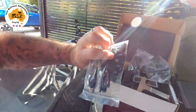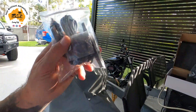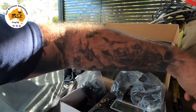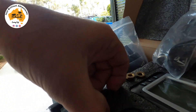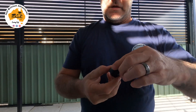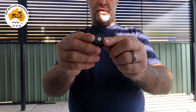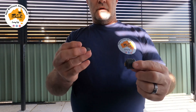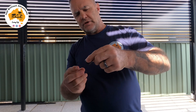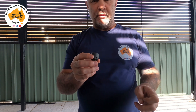That there is a little extender aerial — with the caravan, this allows the monitor to read all the way back. You can put this aerial in your car if need be; I've found in the past I haven't had to worry about it. Now I'm going to take one of the little sensors out — all the sensors are numbered. This is the actual sensor itself; it just screws straight onto your tyre. I'm going to pull it apart — it just screws off. You'll see number eight, so this is obviously going to be the eighth tyre. You place it over your wheel, place on the little brass screw, screw this in, then tighten the brass fitting so it can't move, and put your cap on top and screw it on.